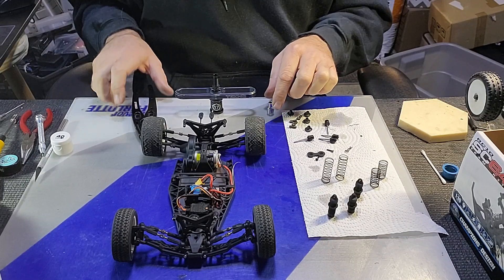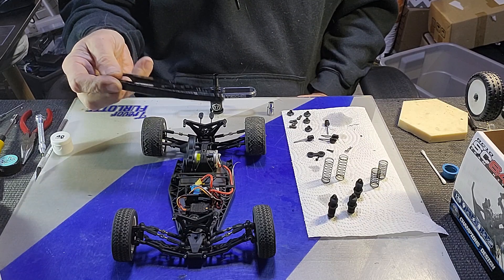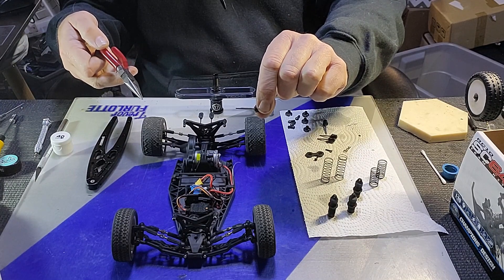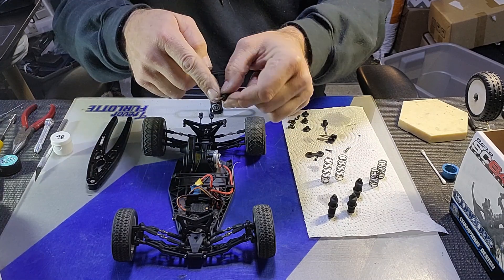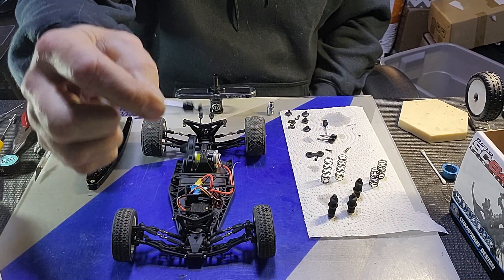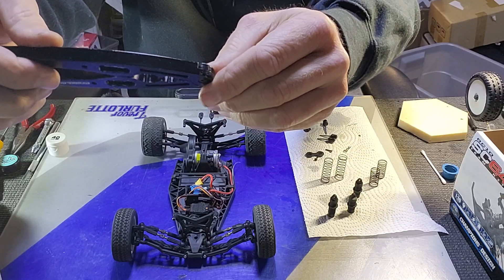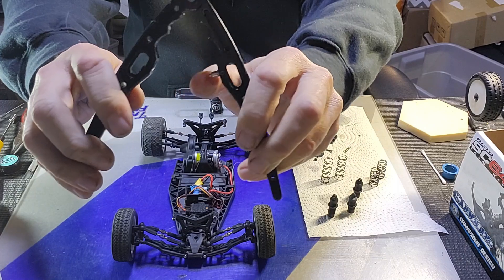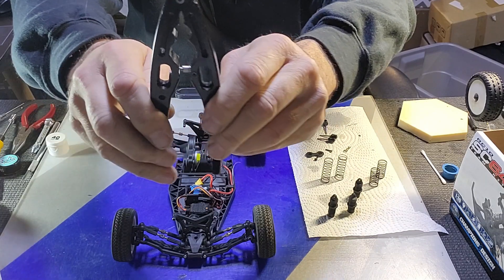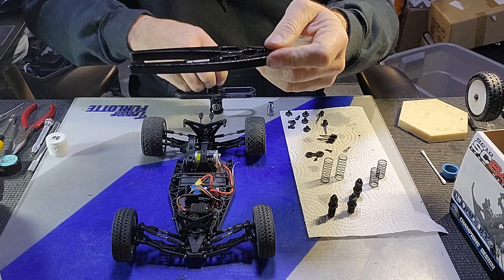In order to do this, you need a couple of tools — I'd say three. First: shock pliers. Shock pliers are great because they are coated and you won't mar or scratch up your shock shafts. If you hold the shock shaft with regular pliers to get the ball cup off the bottom, you can scratch up the shaft. If you scratch the shaft, it will nick the rubber O-rings inside the cap and cause leaks.